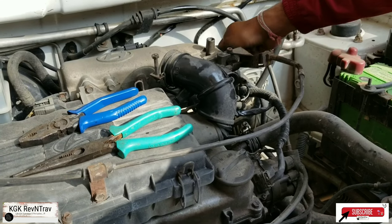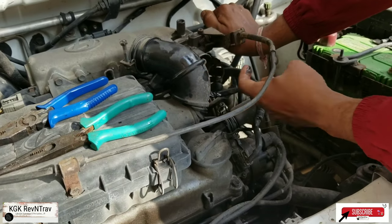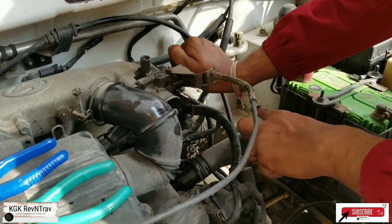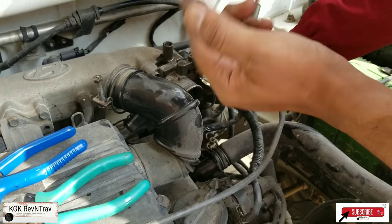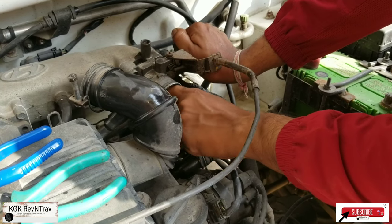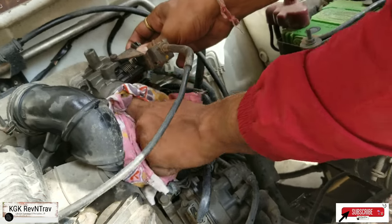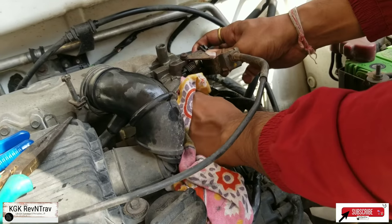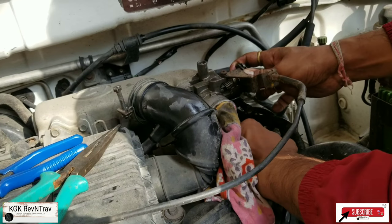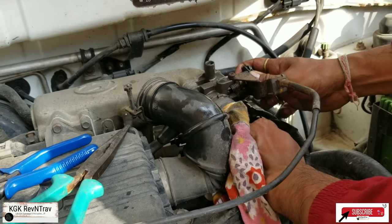I'll try to leave it for some time, hopefully everything will come out. This is the current situation of the throttle body. I should not use my hand and I would advise people not to use their hand either — I would suggest using a brush to clean it up. Just be careful not to bend the flap, because if you bend the flap it would be very difficult to replace. I am taking every precaution to open up the flap and not pressing it very hard — I am being very gentle.